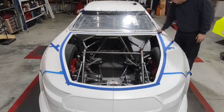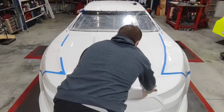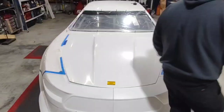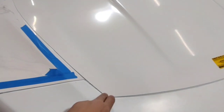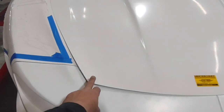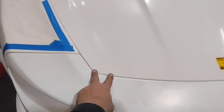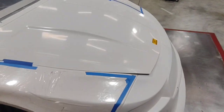And there we have it — we've got nice tight gaps all the way around it and it sits down in its channel perfectly. That's the best way I've found to mount a hood. By the time the hood pins get in, they will hold these corners tight. This is just the fiberglass doing that — nothing wrong with the way we've done anything. It's just kind of held up but now we've got great seams all the way around. We're now ready to put our hood hinges in and the hood pins, and this thing is ready to send home.